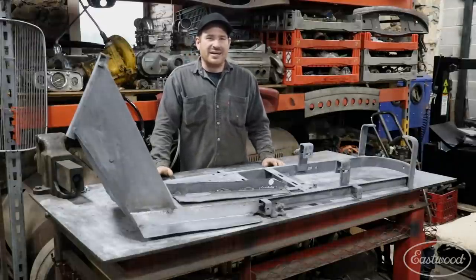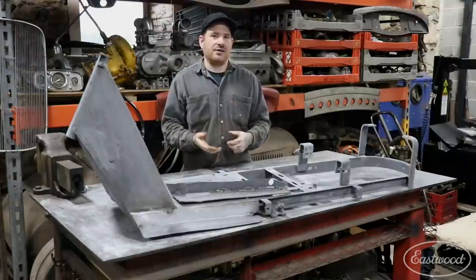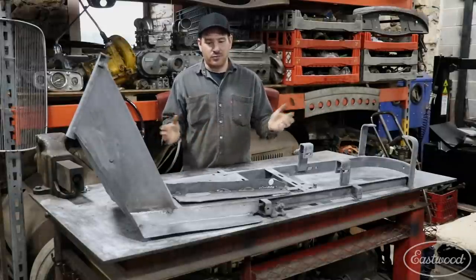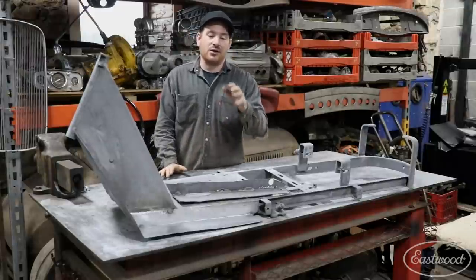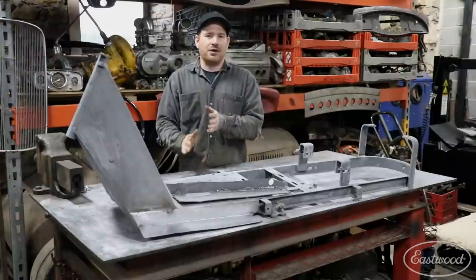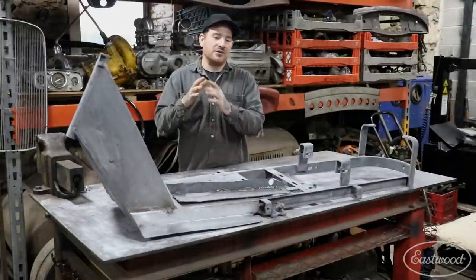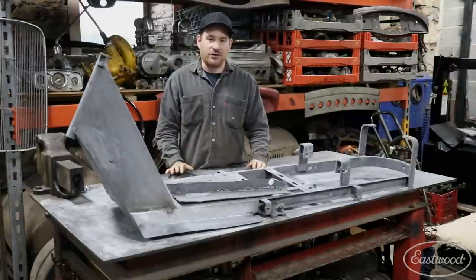In those last couple shots you saw where I went ahead and used some Rust Encapsulator Plus, just brushing it into the channel there that was hidden when it was blasted - we obviously couldn't get in there to clean it up, so I wire brushed it off and coated it with the Plus. Then I sprayed the backside of our patch panel with some self-etching weld-through primer, got everything nice and coated and sealed up so when we weld it together we're not going to have any issues with things getting rusty over time. The welding went pretty smooth with the blasted metal, new metal, and good fit up. In the front corner where the running board meets all these different sections, I welded up that corner with the three-part corner and smoothed out the visible seam rather than filling it with body filler later.